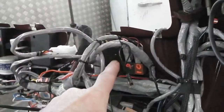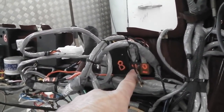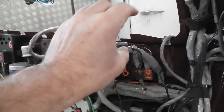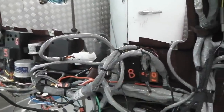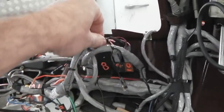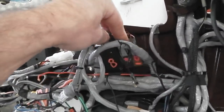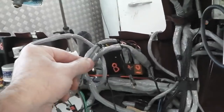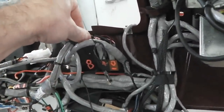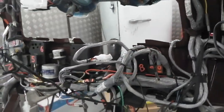This is to do with getting the auto wipe system online, and also for an interface to the stalk control so it can perform the action that I wanted to do, basically inverting the switches. Those read up, they can come out again out front if you needed to look at them for any reason. We'll have foam cushion pads on everything so there's no rattle. You do not want this. Everything's got to be thought about in terms of vibration.